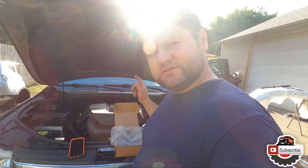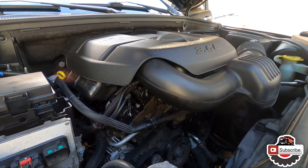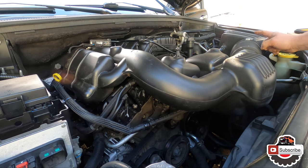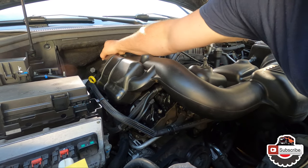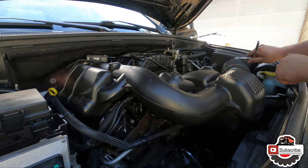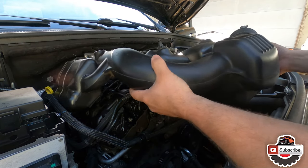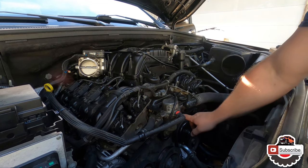Let's go after it. Let's get it swapped out and then we can see if it actually works. First we're going to remove the engine cover just by prying it up. Then we'll remove this intake assembly by undoing the 8mm bolt right here, and then another 8mm bolt on that side, and then this little clip by simply pressing on this tab.